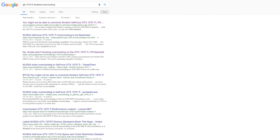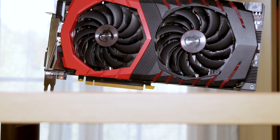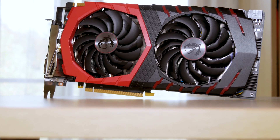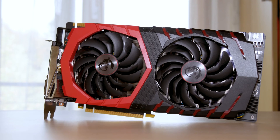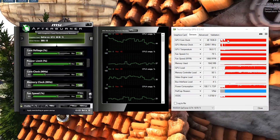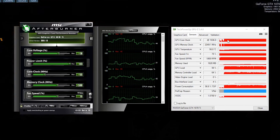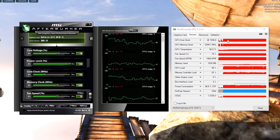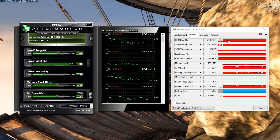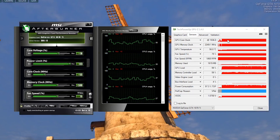Although there were rumors about the GTX 1070 Ti being locked down for overclocking, that turned out to be false. Perhaps the locked part was actually just for manufacturers — as in they are not allowed to factory overclock them as per usual — which would somewhat explain this unusual situation. Nevertheless, I managed to increase GPU and memory clock speeds using MSI Afterburner, getting around 500 MHz more on the memory and setting the GPU speed at around 1950 MHz on average.